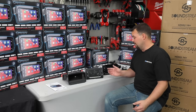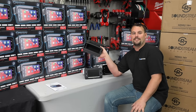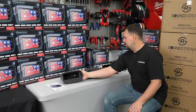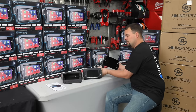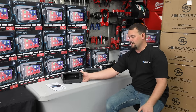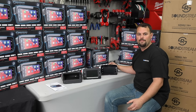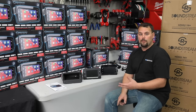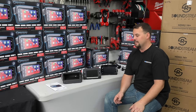If you've got an Electroglide standard, it does not come with a radio at all — that's an even bigger deal. This radio is going to bolt right in where the pocket went, right in where the GT radio or the new GTS radio goes. If you had an Electroglide standard, it's going to be pre-wired with a factory Harley plug that plugs right into the new Soundstream radio. The only thing you won't have is a factory USB, some speaker wiring, and an antenna — but we have a package that answers all of those questions and includes the speakers you'll need.